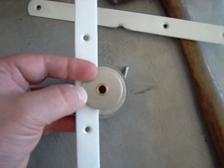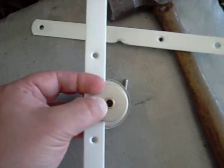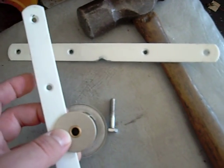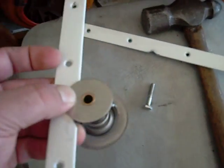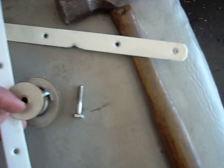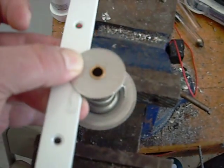There's a hole right here, as you can see where my thumb's pointing — it goes directly down to the heat motor. Once you have both white brackets on the right and left side fully supporting that stainless steel flat washer, you're going to use that quarter-20 right inside this hole. Stick it down in there and put the assembly in a vise just as we're seeing right here.